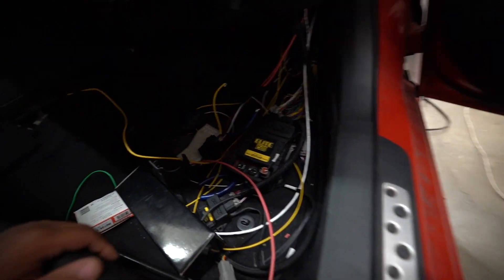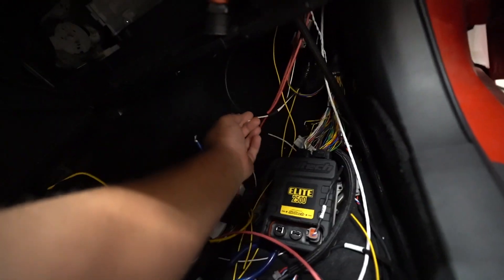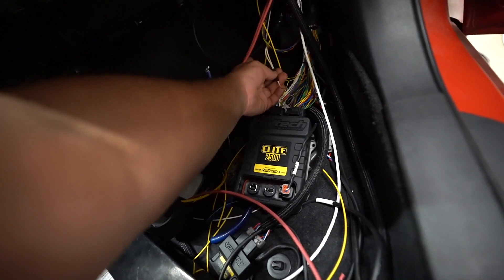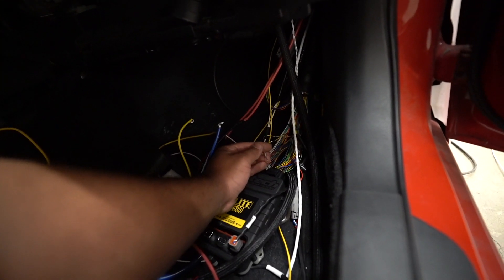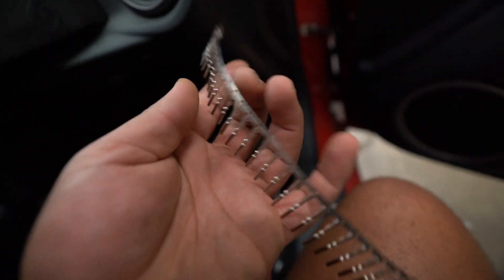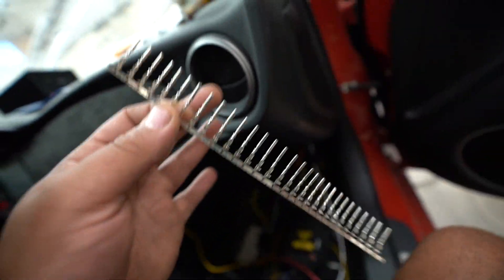Moving into the car. It's a bit of a mess, but this wire right here is for both of my fans. I thought I had the right pin before, so I'll cut this off, strip it, put a new pin on — these barrel pins — and put it in the ECU. Then do power and ground.